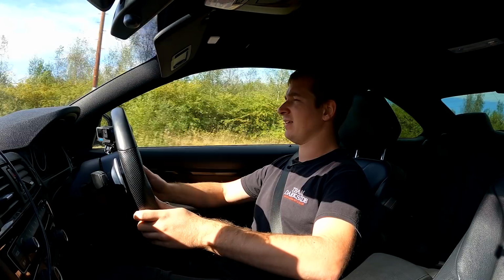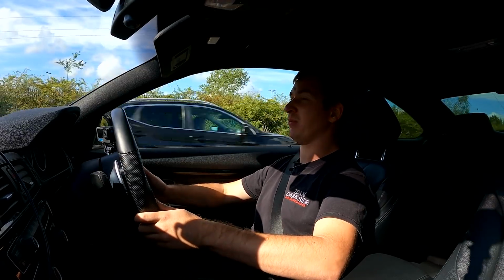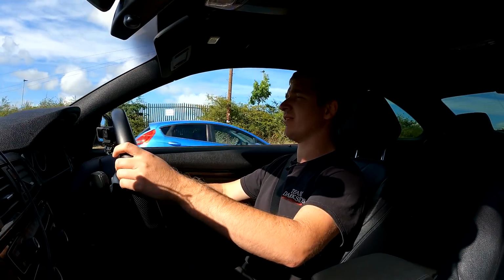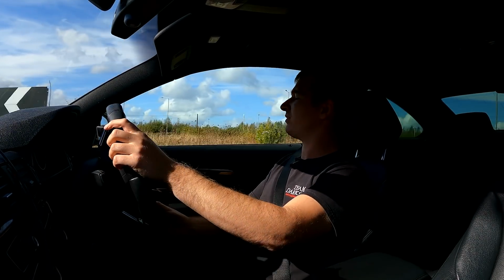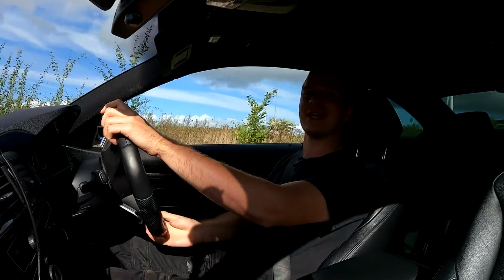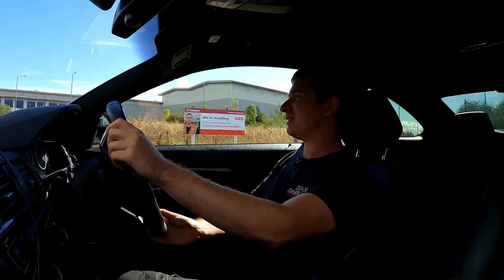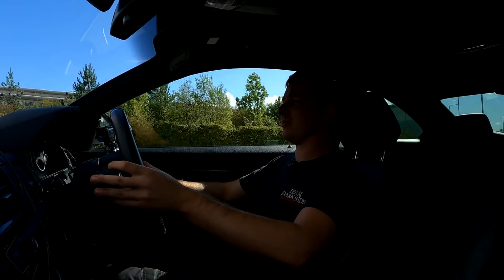The gearboxes on these are super strong. They do fail, but that's usually standard abused cars, so we can only see if Matt's really concerned about his gearbox. We could turn it down to pretty much whatever torque number he wants, but it's above the factory rating. Everybody always goes on about the factory ratings, but the 6-speed running in the Golf Mark 4s is run right at its rating as standard, and there's people running 1,000 horsepower with them. They do break eventually, but I'm not to worry too much.